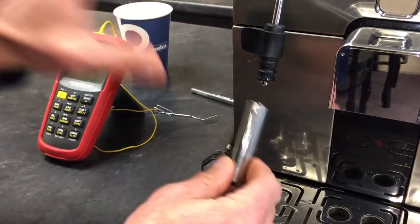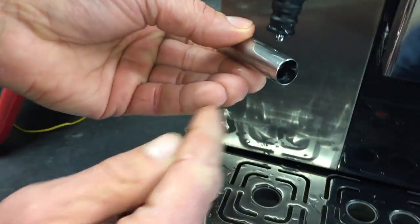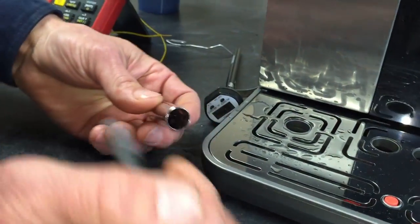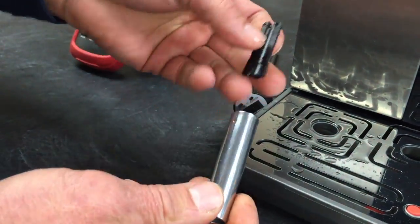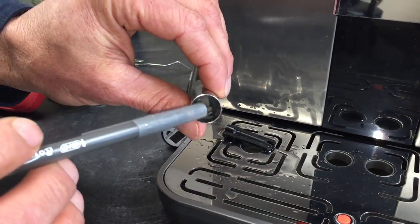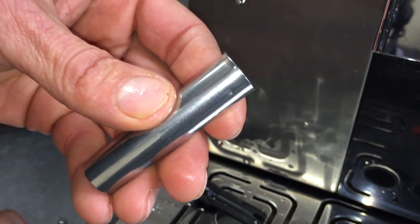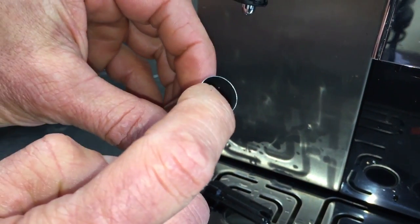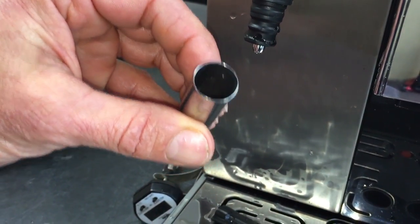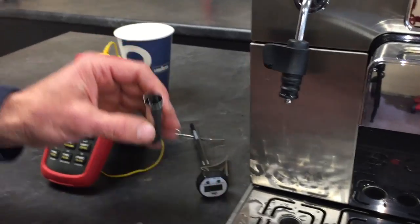If it is getting hot but you're not getting froth, just do a quick check on the wand here. Take this piece, push it down on the counter, and pull it out — you're just using a pen to push that up. Make sure that's nice and clean. Look down the side and clean it out — maybe if you have a brush of some sort. The key thing is this little hole here. Make sure that hole is clean. If you hold it up to the light and see light through it, you're probably fine — but I still recommend trying to stick something in there to clean it. That hole being clogged is one of the biggest problems, because if it's clogged, it can't get air in to actually put air into the froth.